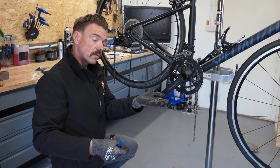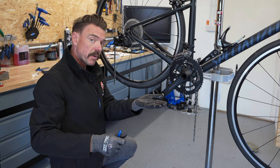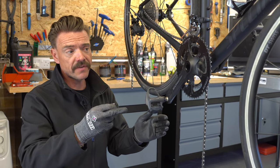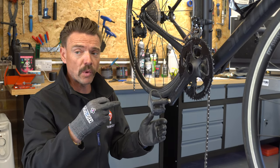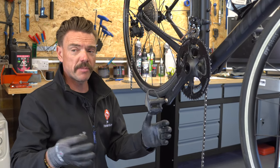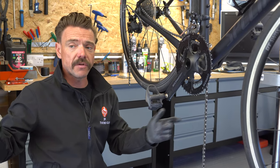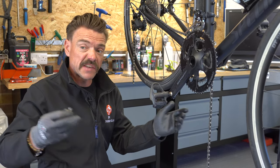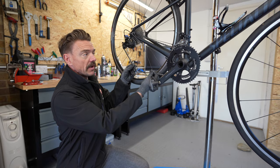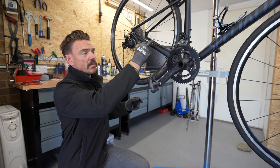So what I've now got is two clean ends of chain ready for my quick link. Before you start doing this, it's a really good idea to shift your bike into small-small — that is the small chain ring and the smallest sprocket at the back — purely because that takes all of the tension out of the system, removes the loading from the springs in the two derailleurs, and releases the most chain for you to work with. Definitely do it underneath the bike.